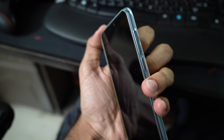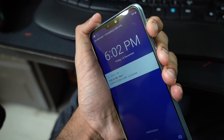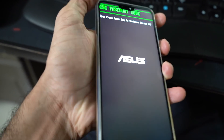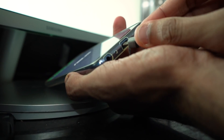Now on your Max Pro M2, press and hold the power button and volume up button simultaneously until this screen appears. Now your phone is in fastboot mode. Connect the phone to the PC via a micro USB cable.